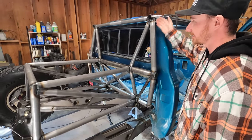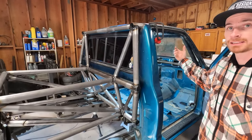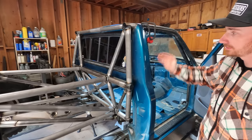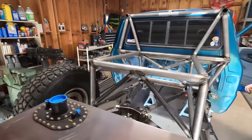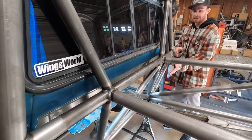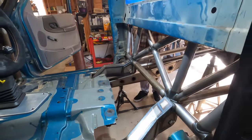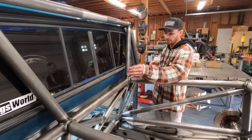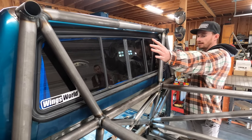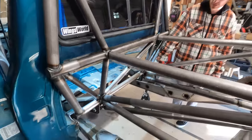Just a little backstory — this B pillar is external. The top portion of it is outside of the cab, whereas normally on pre-runners or any off-road truck, the B pillar is inside. But this being a regular cab, I wanted him as comfortable as possible. The seats were already leaning up against the back window, so having a bunch of two-inch tubes back there in the cab means your head is way too close. So we brought the top of the B pillar outside of the truck, and then the bottom, basically from the belt line down, is all raked back in.